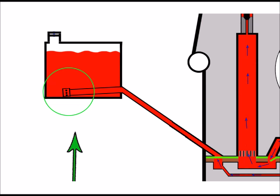In the past, I have removed fuel filters and cleaned them slightly and blew through them to see if there is any restriction there, but I can't recommend that to everybody because of the potential dangers of fuel contacting the mouth. So what I tend to do nowadays is always have a fuel filter on standby for the price that you can get them for, just a couple of pounds. It's best to have one on standby so that you can just replace it anyway.